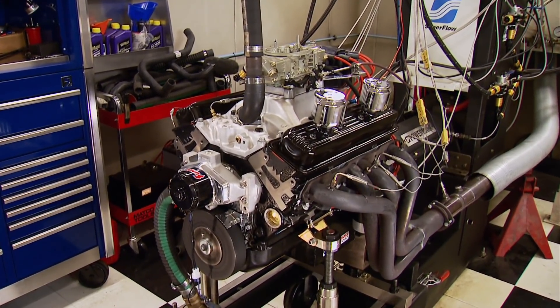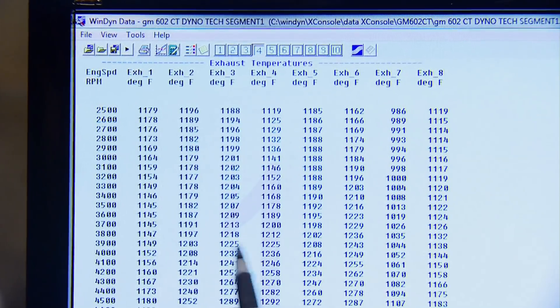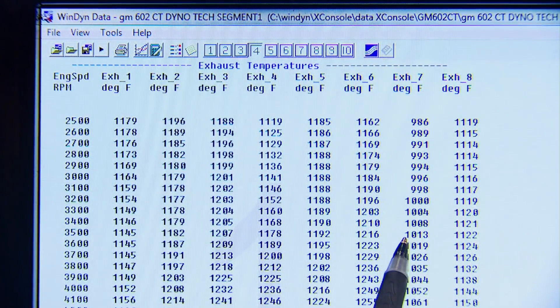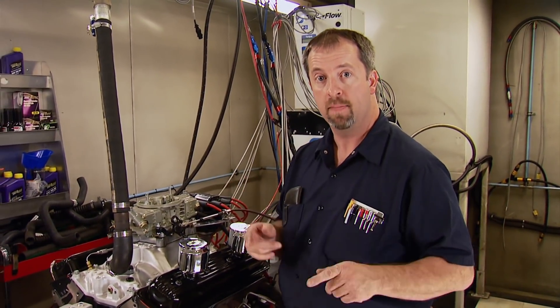The PC records all data during a dyno run. Here's what the recorded data looks like for each EGT — each line represents an individual cylinder. When the engine fires up, heat is monitored as it exits the exhaust ports and reported to the PC. This is used as a tuning tool when setting up a new engine. As we can see, cylinder 7 is the coldest, which most likely represents an uneven distribution issue with the manifold. This was just a start to get you more familiarized with how the dyno actually works. In future dyno sessions, we'll include simple explanations to get you up to speed on some of the other capabilities this machine has. Dyno time is expensive no matter what you run — sessions start from around $500 and go up. But it's well worth it so you don't get classified as a keyboard rambler spotting numbers — you have proof.